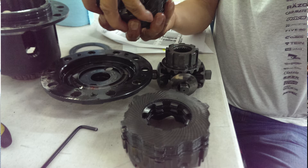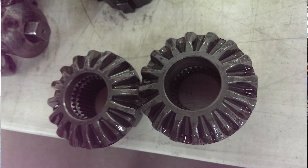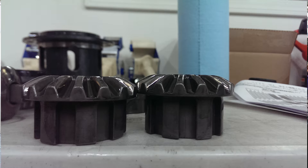In the background you can see a set of four gears lying on the table with a gear on top of them. The gear on top is the side gear — it has splines in it for the axles to go into. In the next picture you can see one of the side gears on the side of the table. Those four gears are really what make the differential a differential — they allow the axles to rotate separately. In this picture you see the two side gears, both splined on the inside, which is what the axles go into.